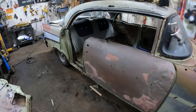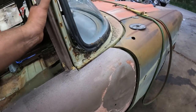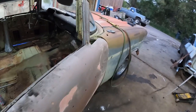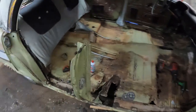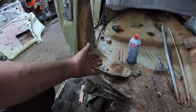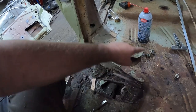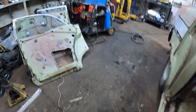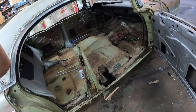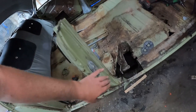We're making progress — at the very least I know how it comes apart. We've got the door hung. It's hard to tell — it fits good there but this doesn't, and this kind of moves, so we'll wing it. The way this fits: pretty simple, it fits along the rocker just like usual, and this little outrigger goes into the floor. The post is back now. The issue we're going to run into: the door wants to hit all of this stuff because the back of the door is a different shape on the four-door to two-door. So I think this section here might have to go and we'll fill it in down the road.